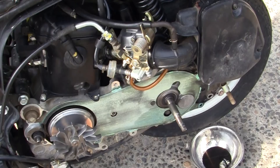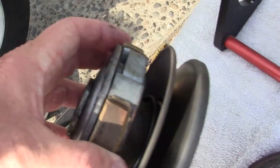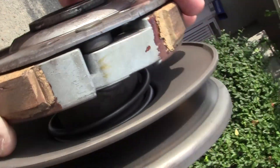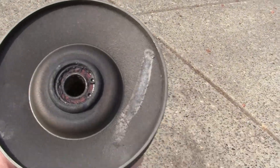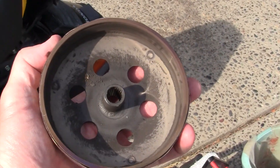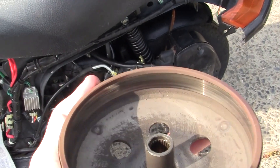I'm going to clean up the clutch, tear it apart and show it to you. The clutch is right here. The center clutch spring is right inside — you'll see it when I take it off. There's a little bit of grease on the back here, I'm going to clean all that off. This is your bell housing which the clutch pads run on right here. I'm going to clean that up and run a little sandpaper on it.